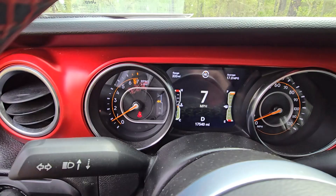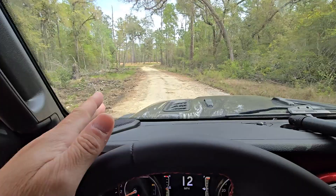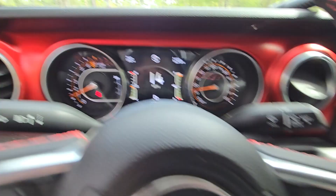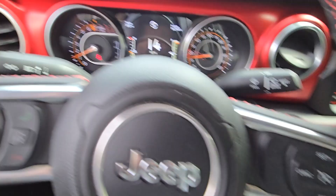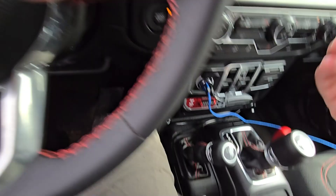We're engaged in four high. Now I could go back to two high, but notice I'm on a turn — it's better to do this in a straight line rather than when your wheels are turned when you're engaged in four-wheel drive, so everything meshes nicely. Once we come around and we're straight, reach down, push it forward, and now I'm in two high. Grab it again, pull it down — back in four high. It really is that simple.